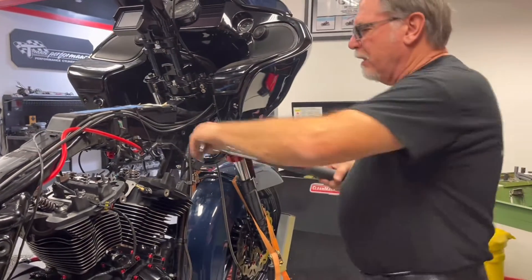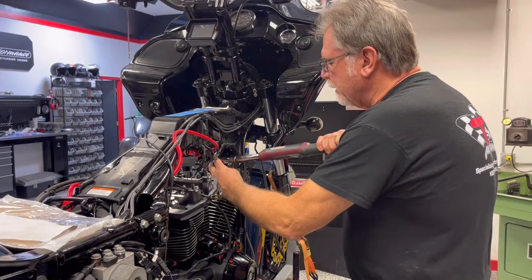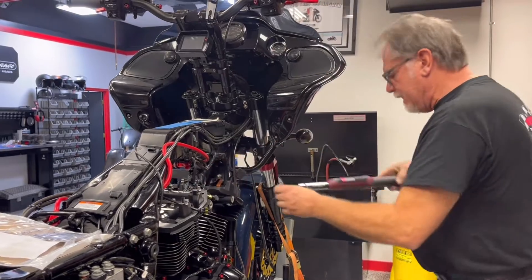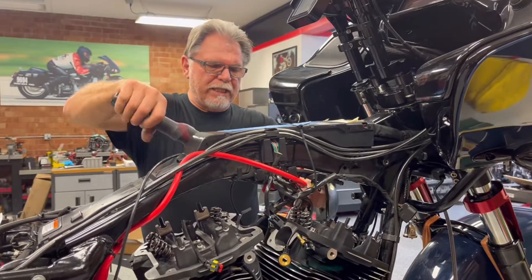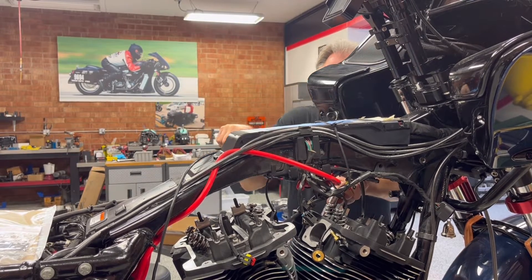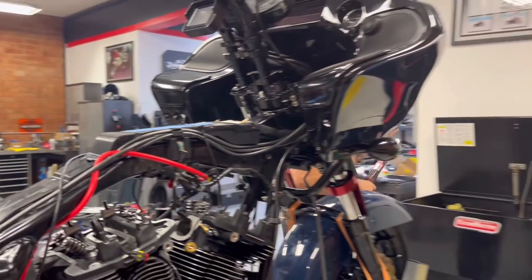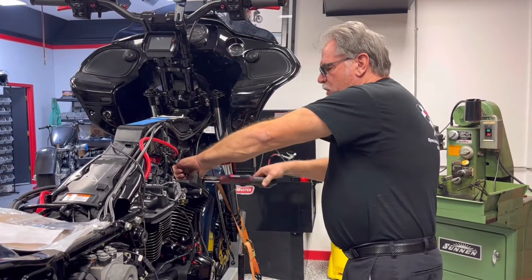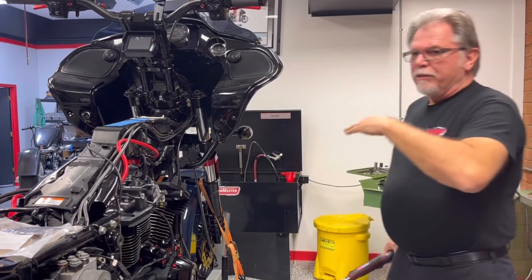Then I come over here and do number two — a nice steady pull. You can see it's not jumping or gripping or anything like that. The reason I put 48 in the middle is because when you're doing these in the chassis and you try to go from 28 to 90, you run out of swing and have to stop your pull. In my opinion, that's one of the worst things you can do. Also, if you look at ARP and all the people who recommend the way torque hits, they always want a nice steady pull with about a 15 to 20 pound difference in each pull.